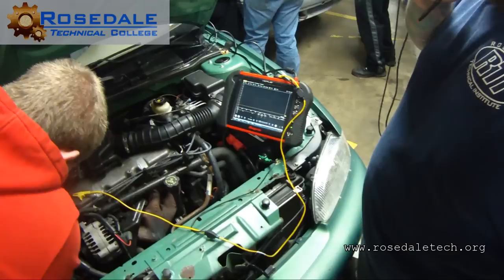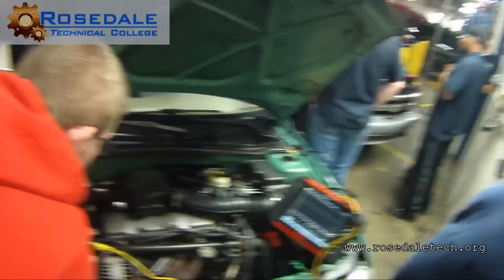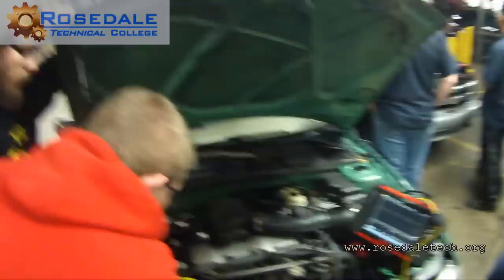And then put your scope back on that pin. That should be a steady 5, and it shouldn't change. Now wiggle that section of the harness again. That means this is an intermittent issue, either because the plug is loose or the sensor isn't good. It's steady as you're wiggling that. Let's plug it back in and check it again.